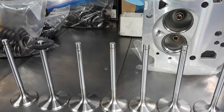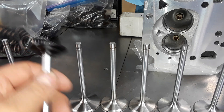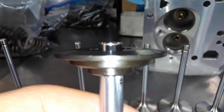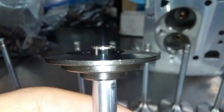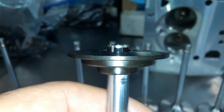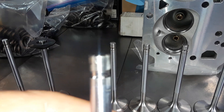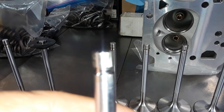One other interesting thing about this particular head is there's a little gouging on all of the intake valves, and witness marks on some of the exhaust valves. I have no clue what caused it. You can see the gouge — all of them have it. It's about five-eighths of an inch below the top of the valve, and three thirty-seconds of an inch below the retainer. It's nowhere near the locks or the keepers. Every one of the intakes has it.